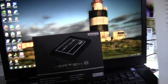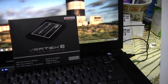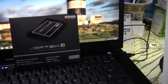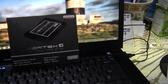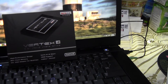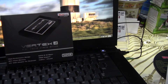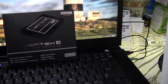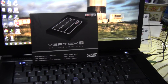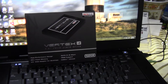I don't want to misquote anything, so I'll read the specs. With the SATA 3 interface, you have a sustained sequential read of up to 560 MB/s and write up to 510 MB/s. The 4K random read is up to 95,000 IOPS and random write is 85,000 IOPS. The maximum IOPS is 120,000 — pretty amazing for an SSD of this size.